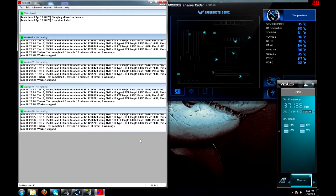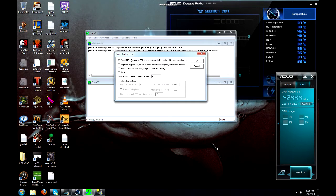We're going to stop all the workers, overclock it back to 4.2GHz, and run the same test. The last time at 4.2GHz it hit 65 degrees Celsius quite fast — let's see if the N520 can keep up with Prime95 and keep things cool. It's done a good job so far. Under overclock settings, it's sitting at about an idle temperature of 37-38 degrees Celsius. We're going to do a Prime95 10-minute bench and see if it keeps temperatures below the 65 degrees we saw with the stock cooler.